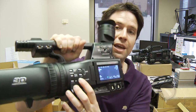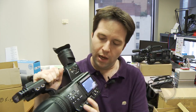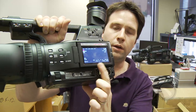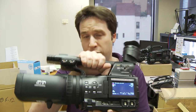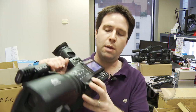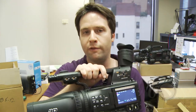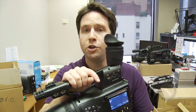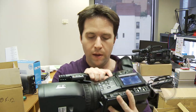Additionally, I have a button called 3D Guide. This 3D Guide button is an essential tool that tells me sort of an acceptable 3D range — Panasonic is telling you, hey, it's kind of where you want to stay within to make good 3D. I hit that button once and it pops on the screen — a little guide that tells me a range of distances from near to far, how far I can go before it starts to diverge too much or get too close. I hit that button one more time and it changes colors and turns into a green 3D logo, saying I want to plan for it to be on a much larger screen. A larger venue means you actually want smaller amounts of 3D because it's just physically larger on the screen, and we don't want to make the audience sick.